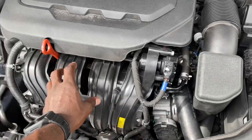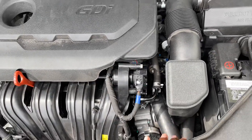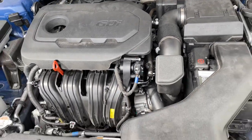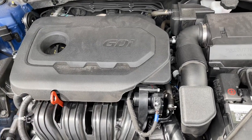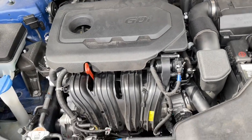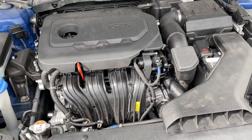The dealer was telling customers they needed a new engine. After reading all that, I found out it's not the knock sensor. The actual trouble code on this car is P2600, not the P1326 for the knock sensor.